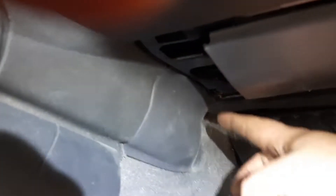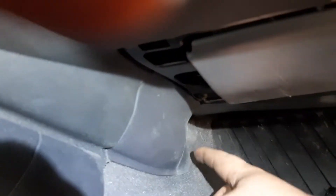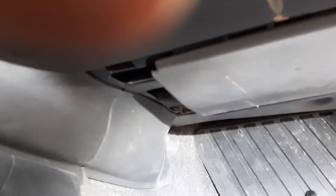One, two, and same thing over here — three, four. All eight millimeter heads. Once you get all those out, just slide the whole box towards you. It'll come out. It might get stuck a little down here — this plastic section will come out.